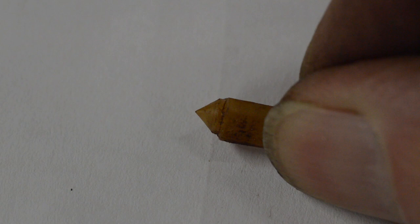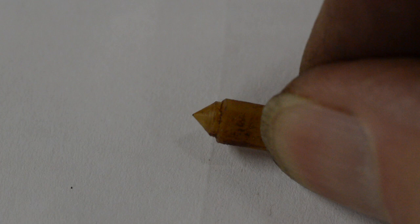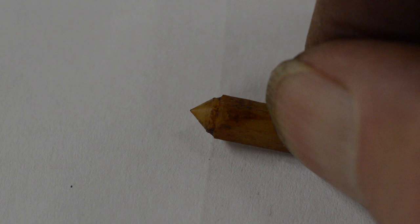I've tried the macro lens to get this in focus. This is the float needle valve - it's the old plastic type. It's not actually that worn; you can see the sides of the tip are fairly clean. But they're not compatible with modern fuels, so I have to fit a black-tipped replacement in metal, which thankfully is very cheap. So this will be removed.